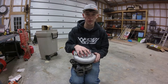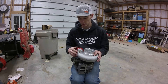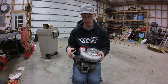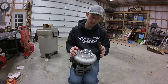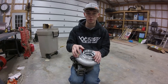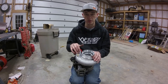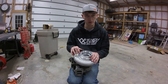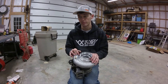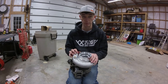With it being an intercooled truck, shouldn't have any problem with the air filter connection. I'm going to send him with a rubber hose so he can hook up the wastegate once he gets the turbo clocked just right how he likes it. This is going to be on a truck that nothing's done to it — stock injectors with probably a piston lift pump, a 4200 spring, some valve springs, and just a turned up pump basically.